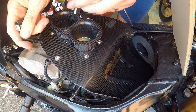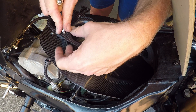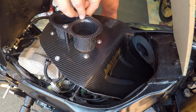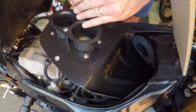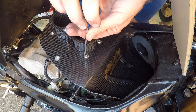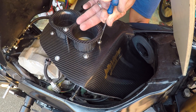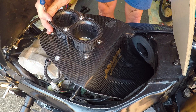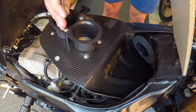The middle bolt has a carbon tube underneath it that goes between the tray and the stack — that just saves crushing the velocity stacks. No need to do them up too tight. Just do that up a couple of turns to get it started. There's really no need to do these up too tight — just enough to feel it nip. If you want to use a torque wrench, you can; do it to about 5 foot pounds. But I just do them up until I feel them tight. There's no need to start bending the carbon, because the foam will seal against the throttle bodies anyway.